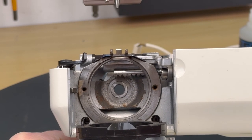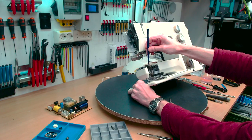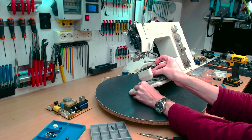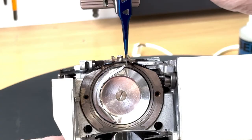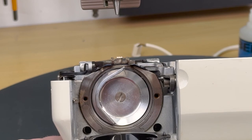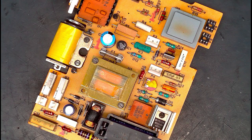To get the hook drive correctly back in place, you take the toothed rack all the way over to the right — as far right as possible. And when you insert it, you align that part of the hook drive to the right inner side of the feed dog, and then it's correctly placed. The CB hook bobbin is the same on every machine, so it's no problem at all to do that.